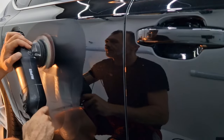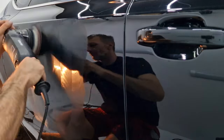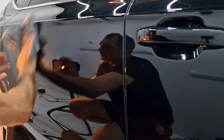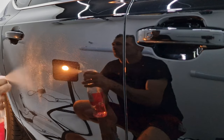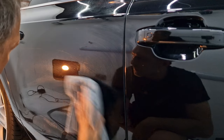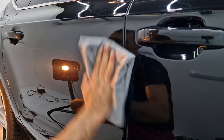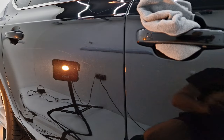Put only a little bit of paste on the pad — not a lot. I'll do everything just like a regular polishing process, but we will not press the machine too much because we don't want to create additional holograms. Using my speed, let's see what we get after I finish. Now wiping it off — it looks perfect. Let me also degrease this area, which gives us an insight into what it would look like after the car gets washed. And this is what you get with the one-step polishing — taken a very small amount of time, but also very quality work.